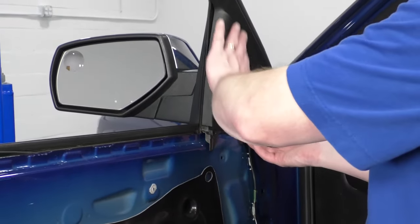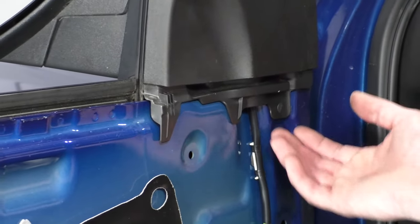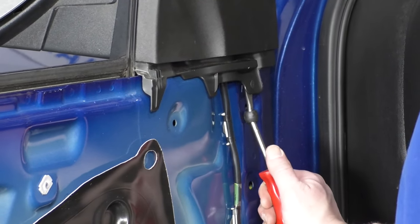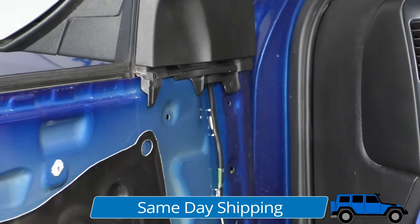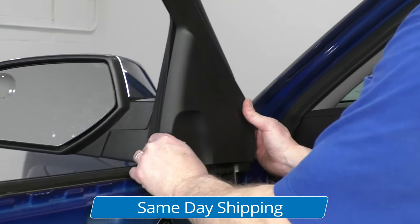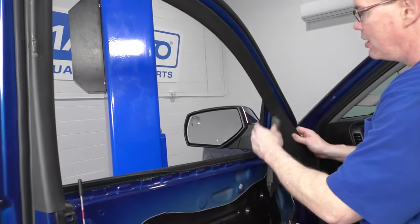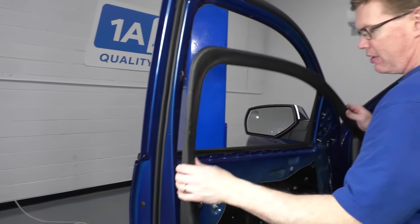With the door panel off, remove this inside trim panel. There's a little clip here that you can usually pull on, and there's also going to be a clip there — it's missing on this truck. The correct tool from 1AAuto.com is this little kind of forceps. Pry that out. If you didn't have one of those and were in a pinch, you could use a flat blade screwdriver. Remove those two pins, and then there's a clip behind here that you have to pull firmly to release — pull this out and down all the way around.